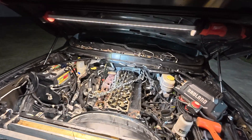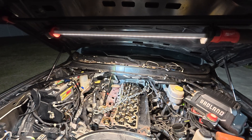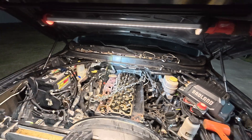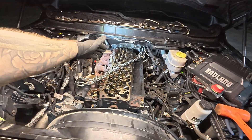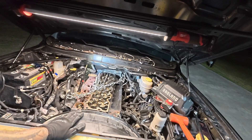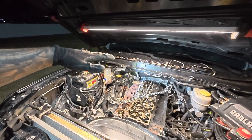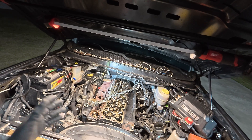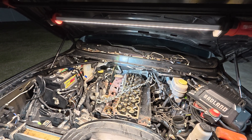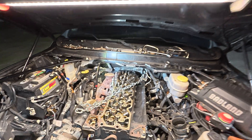The head is finally ready to come off. The most challenging part of this job is the fact that this engine is so long and tucked underneath - the engine itself is probably almost two feet long, so by the time you're standing at the front of the truck you're fully extended just to reach the front. You have to full-on dive into the engine bay. Even on a truck creeper you're at full extension trying to get leverage. Those head bolts felt like 250 foot pounds - I had to use a two foot breaker bar and muscle them just to crack them loose.